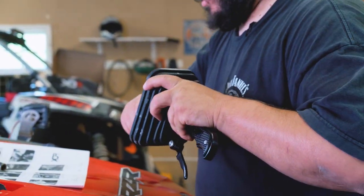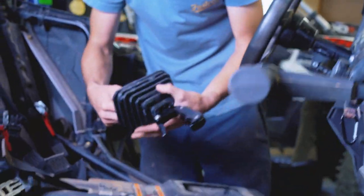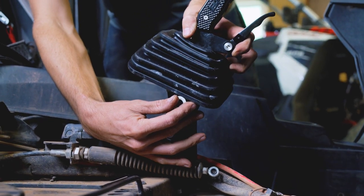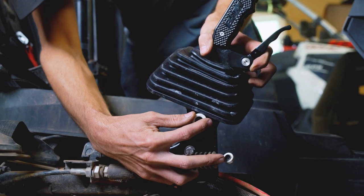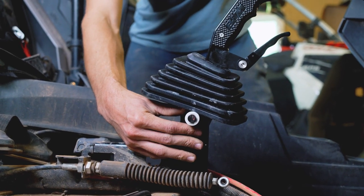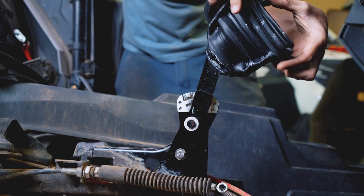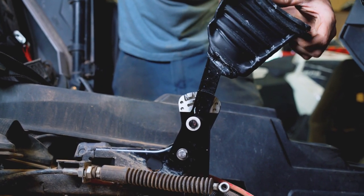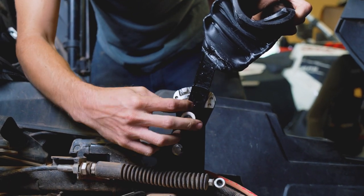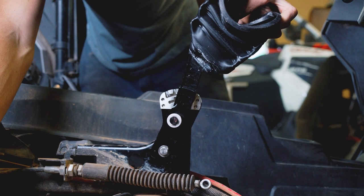And then you gotta put that on the pivot sleeve. Okay, now this is where our shimming comes into play. It's going to say, step 14, this is where it gets interesting now. Place stick onto pivot shaft. Install as many shims as necessary onto the other side of pivot sleeve until shifter operation is smooth. No drag against gate plate.